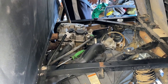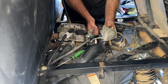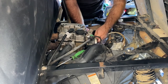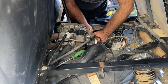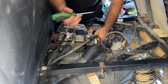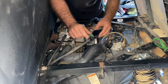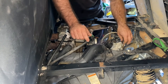Here's our airbox. Now our throttle body — you don't have to take it out, you can just set it over here out of the way. You're going to want to undo your MAP sensor, or your BAP as Polaris calls it — barometric atmospheric pressure. I call them MAP sensors, manifold absolute pressure, because I'm from the automotive field. And then get your fuel injector plug here off.